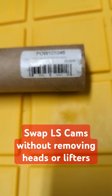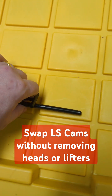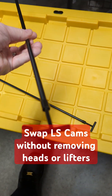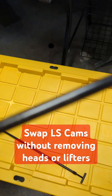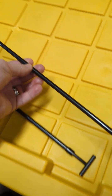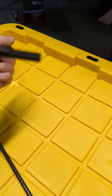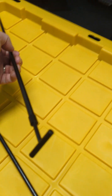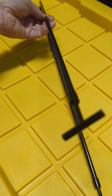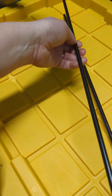What this is — it's like dowels. You can get handles, and it's about 20 or so inches long. You basically shove these in and then you can change the cam without taking the heads off and losing lifters. I know a lot of guys use an actual wooden dowel, but this is a more permanent solution that won't snap in the block.